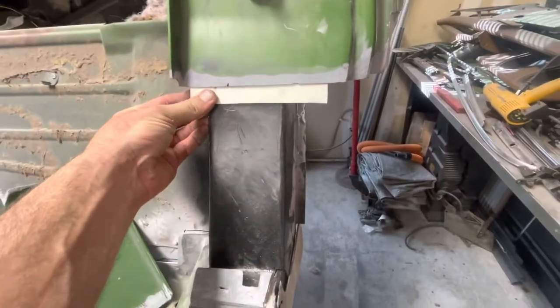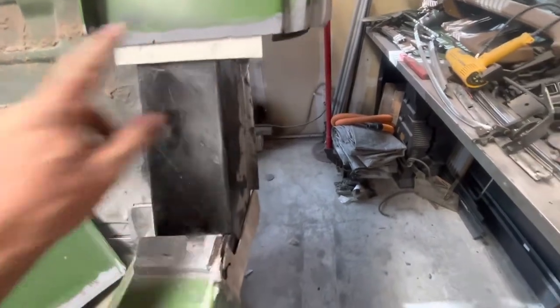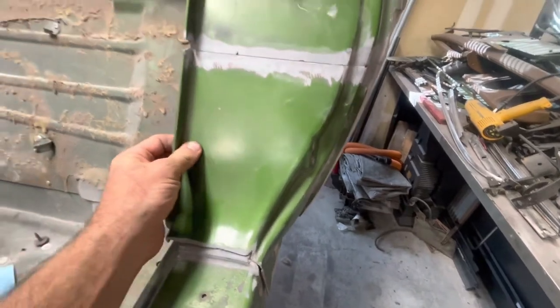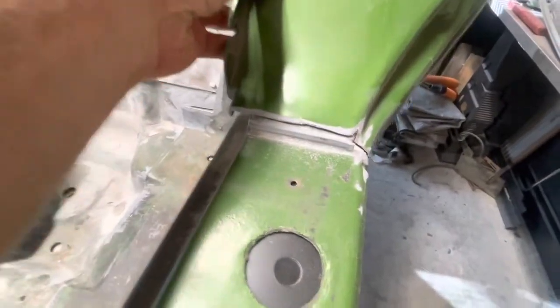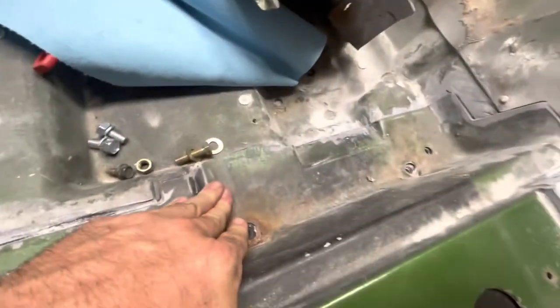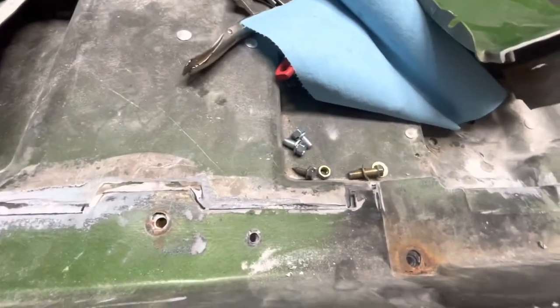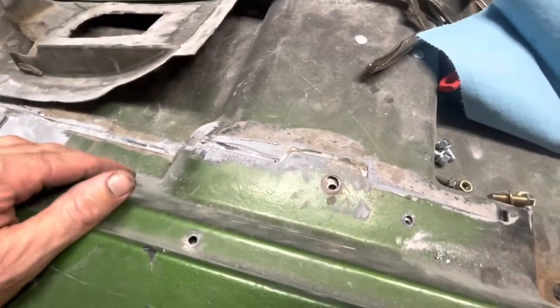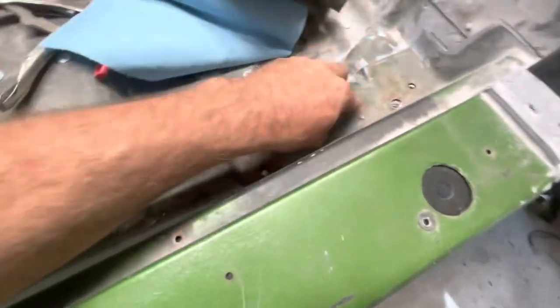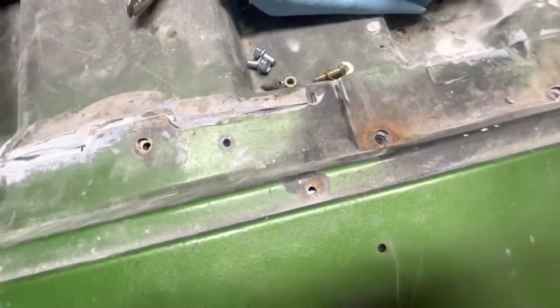All right, so I'm gonna use a bonding strip here because it's a butt joint, and I'll go around, mock everything up. I will take a Sharpie and I will mark everything, all the perimeter areas of each panel. Okay, so I'll mark all this out so I have essentially some parameters on which to apply all my panel bonding. Anyways, I'll screw all these down and try to clamp in the areas that I can't reach anything. I'll use self-tappers.